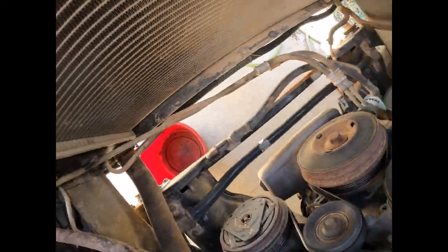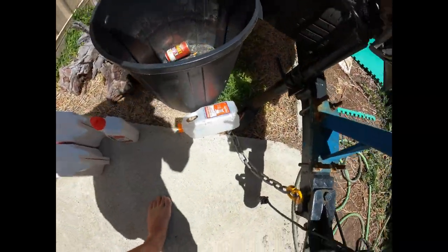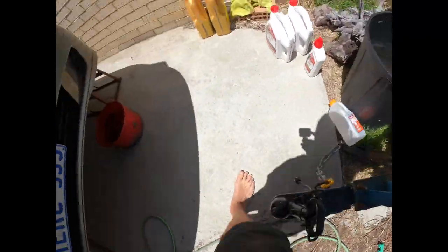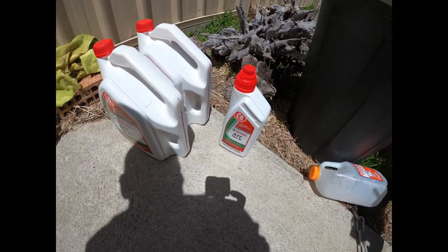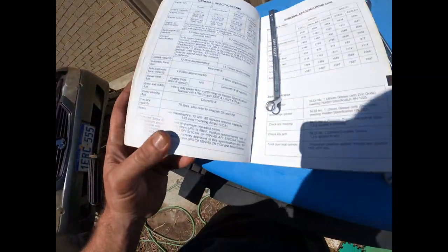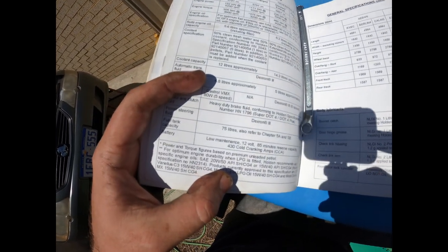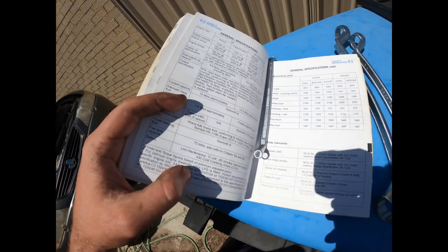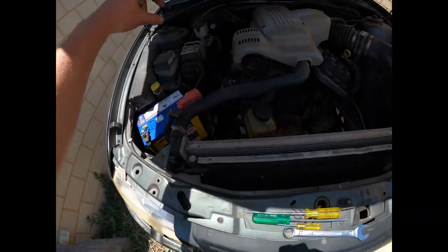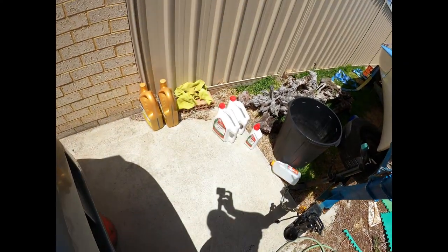The next job is to undo this bottom nut and drop that pipe into a bucket. I'll drain it into a two-litre container just because I'm curious to know how much comes out, and while I'm doing that I'm going to add just a litre of Dexron III. The manual specifies a 4.8-litre capacity, but from what I've read online when you're doing a full flush with the torque converter it takes about 7.9, so I've got that extra litre to run through while flushing and another eight litres for a full refill.